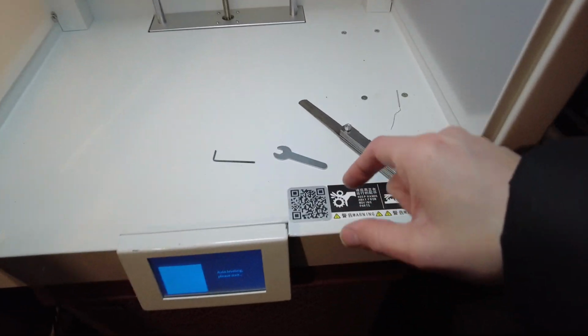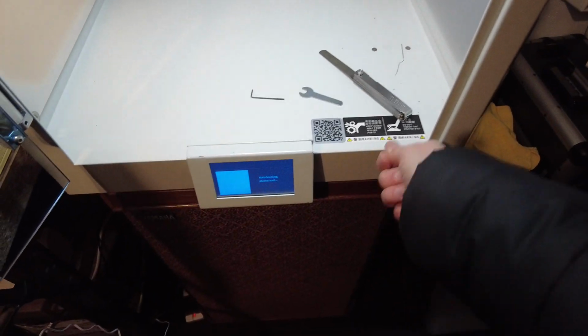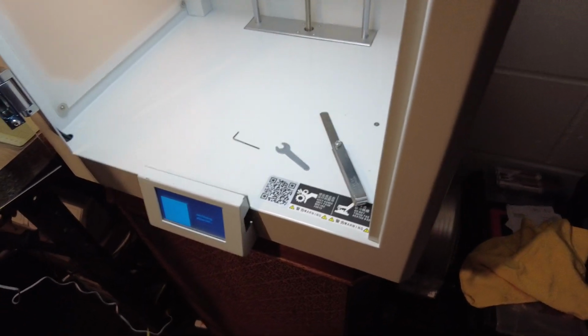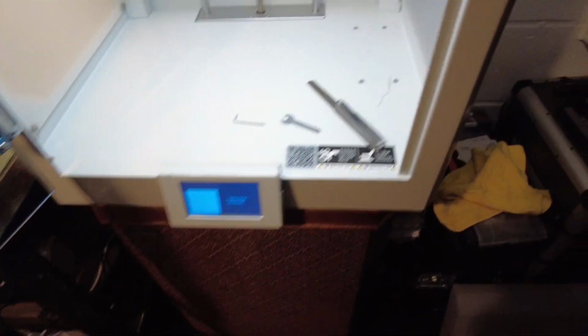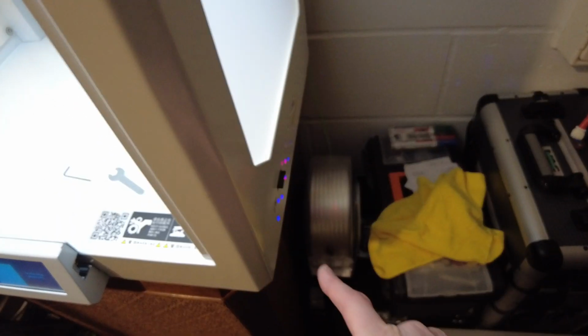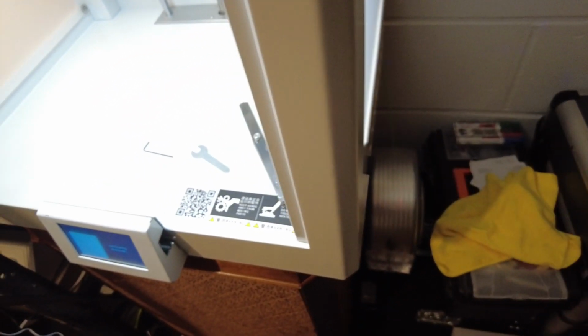I wonder if it's the little extension port that I put on yours that just makes it easy to stick in. For some reason it doesn't read it straight off. But rule of thumb, always start with your file on the SD card, printer off. Turn the printer on with the file in there.